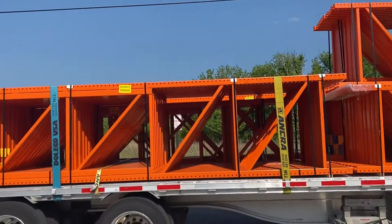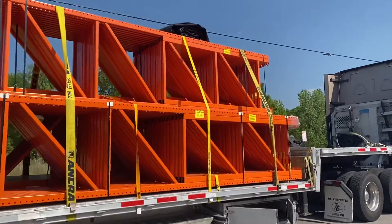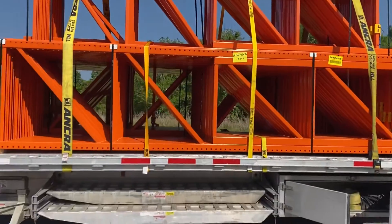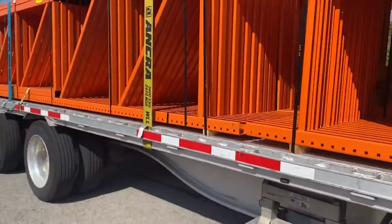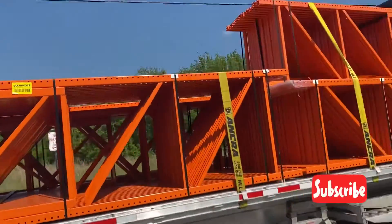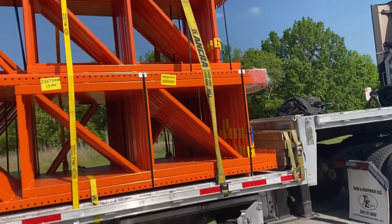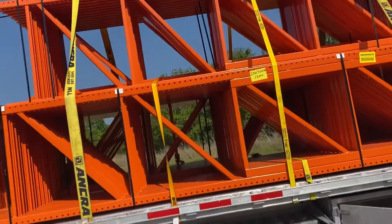These customers want a tarp. The guy already threw the tarp on for me, so I just had to roll it down — it wasn't too bad. I ran one strap through the middle on the bottom and same thing in the back so the load doesn't go anywhere. Then I ran two four-inch straps, one in the front and one in the back, and a two-inch strap across there for added safety and one across the second so they don't shift.